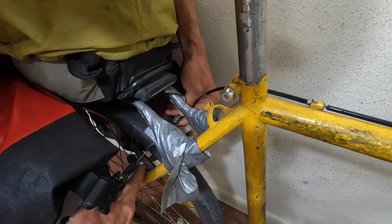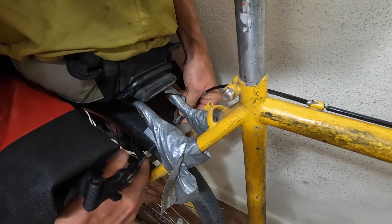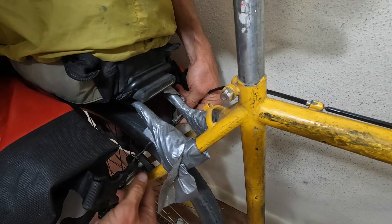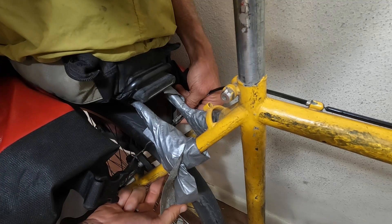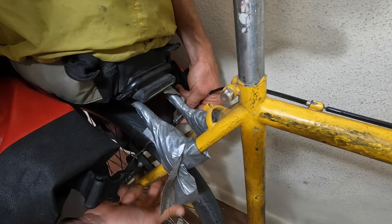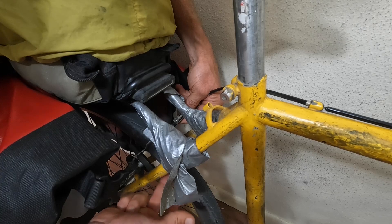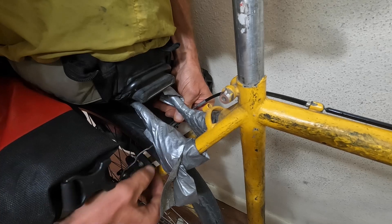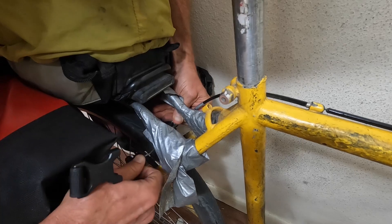I have quite a bit more on the brakes here. There's some uneven wear — that's because I didn't put the brakes on quite right. I get paranoid about raising the brakes too high when installing them, because if you raise them too high they can rub against the tire. So I tend to put them in a little low, which generates a little bit of uneven brake wear.